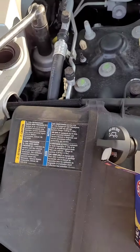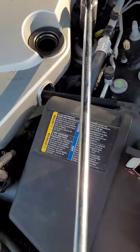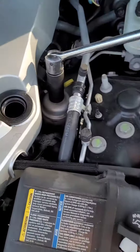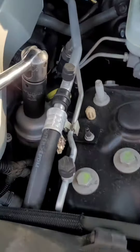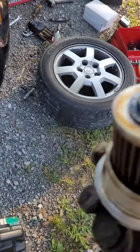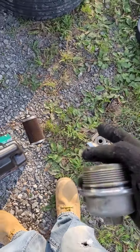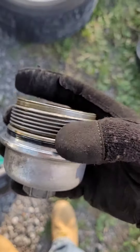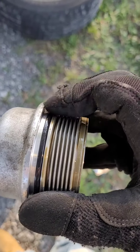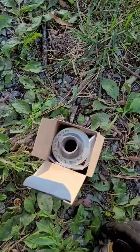24mm. Put it right on there. Ouch! Make sure you bust your knuckle when you do it. Just bend that little finger off. When you unscrew it, that's what you'll get. The filter is going to pop right out of there like that. You see that rubber washer right there? Make sure you take that off and change that too — you'll get a new one in the box.